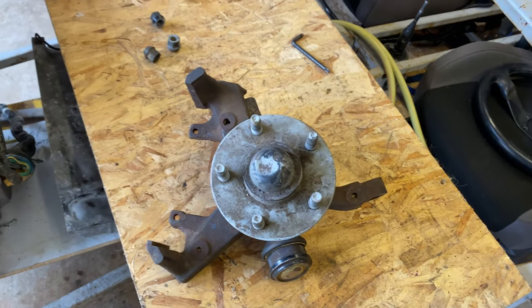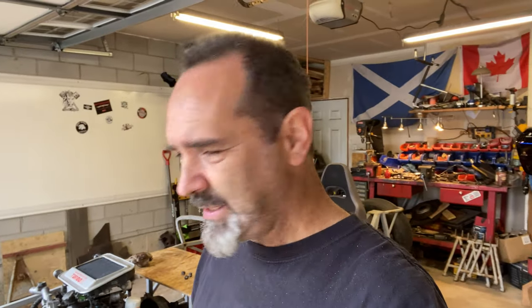So here's my cunning plan - hub adapters. You know those wheel spacers that convert a certain PCD to a different PCD? I've ordered a set of two 4.25 to 4.5 one-inch wheel adapters. Love them or hate them, I actually quite like them. I've actually got a set on Bugsy at the back to convert his stud pattern - been working for a year, no problem at all, no vibration. So I'm good with them.